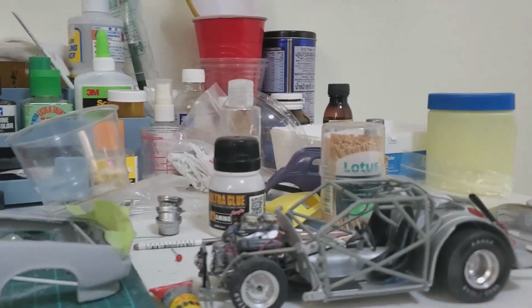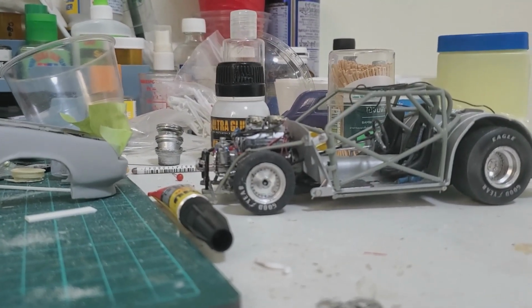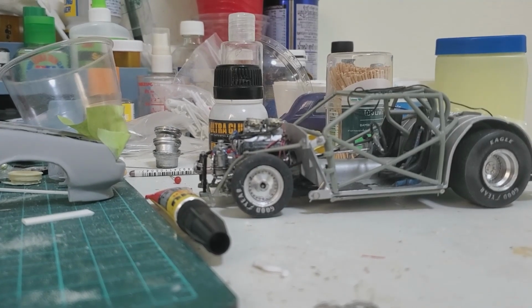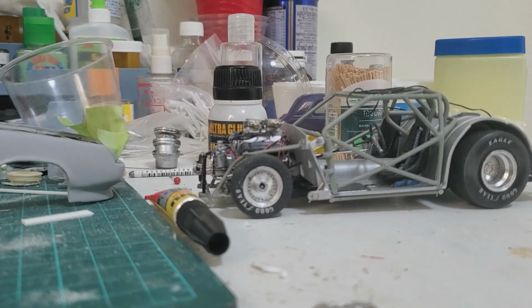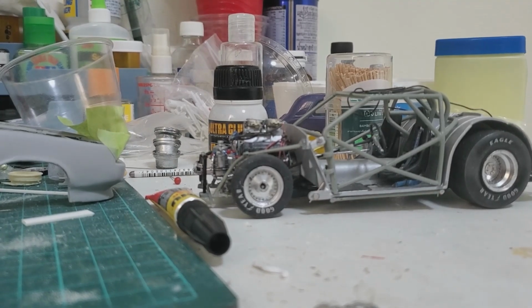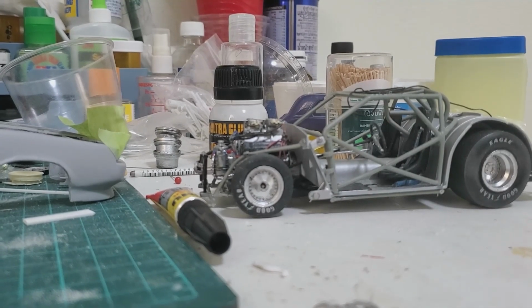As far as I'm going to put the body back on and double and triple check that the door fits right, because I've been working on it off the car, and you can take it off, put it on, and something still won't fit right when it fit before, and you put it back on and it doesn't fit. So I'm going to just make sure that everything's right. And then again, I'll do the same thing with that. I'll hit it with white primer and then start painting.